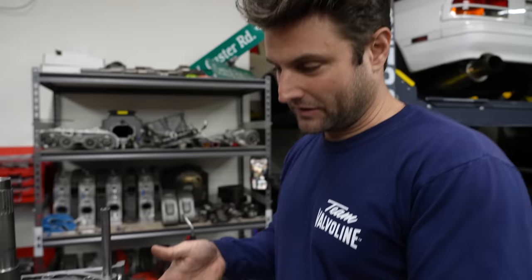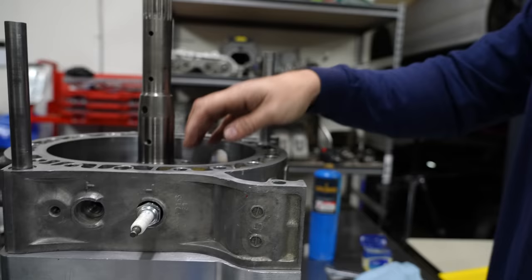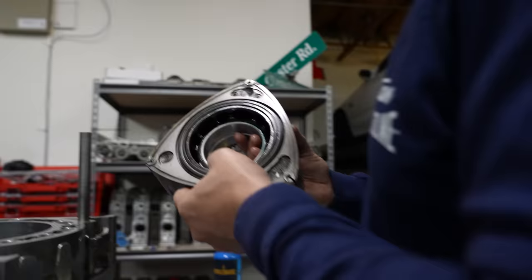Looks kind of the same but different. What's going on is when we stack that side, all the gears were on the top of the rotors, right? But now they're flipped. Rotor three will probably be just as hard as rotor two because we'll have the middle plate that we'll have to align it with, but the engine's already kind of massive, so I think we're good there. In full disclosure, you can see this ring is polished and that shouldn't be.